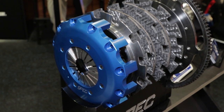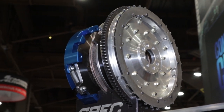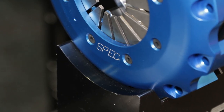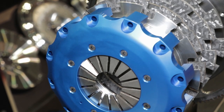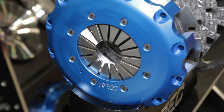What's the advantage of going from a twin disc to a triple disc setup? You've got additional heat control and capacity. Capacity is the main thing — the triple takes our carbon capacity past 2,000 foot-pounds. So it makes it a tremendous clutch for roll racing and standing mile, and it can hold the big power that guys are making now, while still being soft on the driveline and having a tremendous rate of rev.